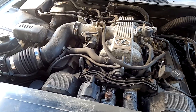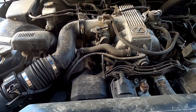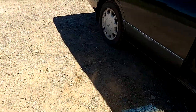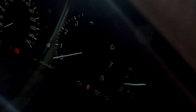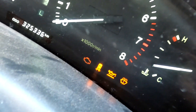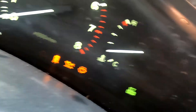Another way, if you're wanting to check an engine like this or check whether a computer's functioning correctly, you actually set some codes. You can do it with several different codes. This one did actually start and run with the airflow meter off - it just idled low, running poor with black smoke out the back. And we're all clear.